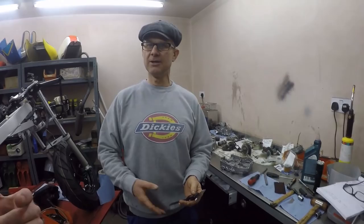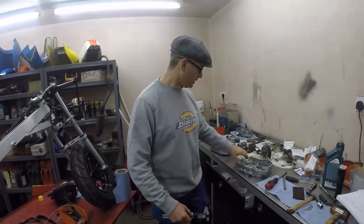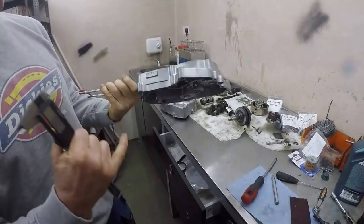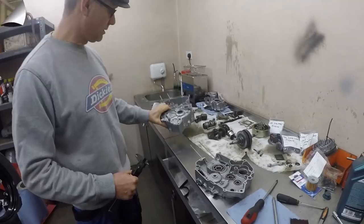The hard bit for Lee was that the engine was complete and had compression and everything looked good, but it was just a little bit scabby — really dirty — and we were going to end up with a really mint looking bike but with a scabby looking engine. So what we've done is we've stripped it down to bare cases, put new seals and bearings in. Every bearing out of the cases, then we vapor blasted them — we've got blasting equipment up here and they've come up really well. There are two types of blaster: dry and wet — vapor blaster is the wet one.